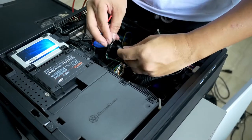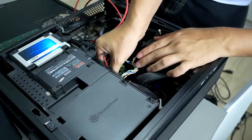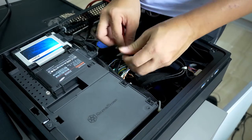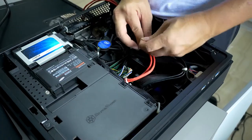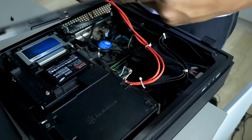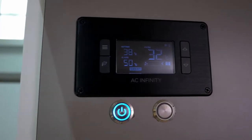This allows me to power up or reset the PC without having to open the door every time. I've also wired the LEDs of the buttons so that they reflect the hard disk activity and the on/off status of the computer. The power button is on the left to show the on/off state of the CPU, and the reset button on the right also shows the hard disk activity.